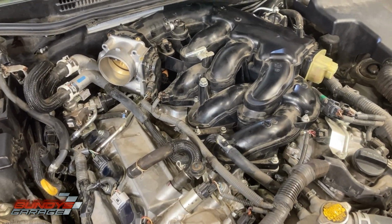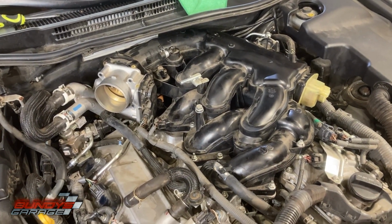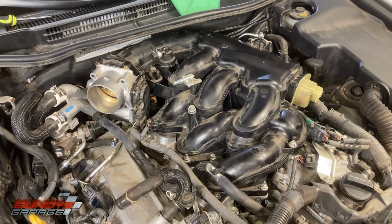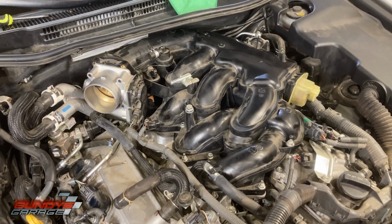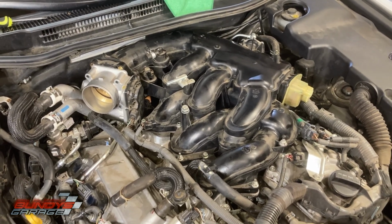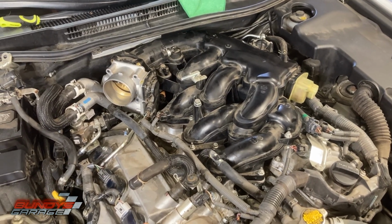The hardest part was getting those intake bolts out. What a hassle, man. Broke my first tool, then I had to go get a T-handle 5mm Torx hex from O'Reilly's. I'll put a link in the description below to that, but there you go, guys. If you've come this far and you've gotten this much done, you guys can put everything else back together.